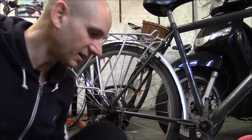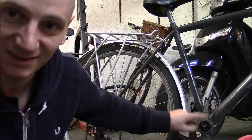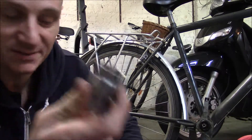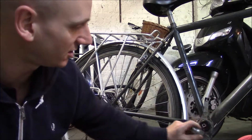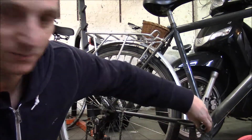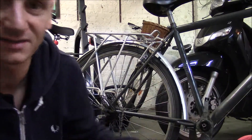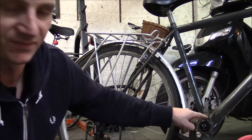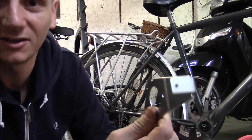Now the tough bit, which I never seem to do well, is this awkward plastic lock ring in the middle. You're supposed to use the lock ring removal tool, but this never seems to fit properly. So I use a soft hammer to hit it into the slot — you can see all these slots in there — and then use an adjustable wrench to turn the whole thing with the plastic ring anti-clockwise. Don't forget: lefty loosey. Turn it to the left. Once that comes off, you can fit the chain guard holder — and that's basically the end of the job.